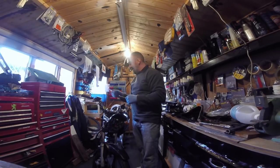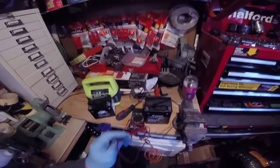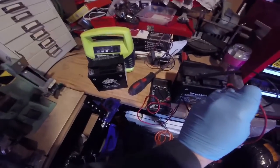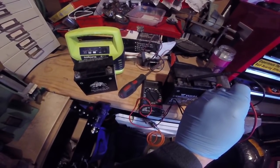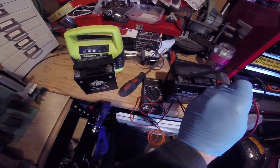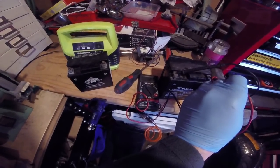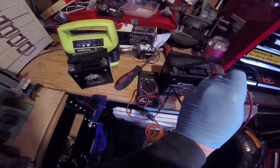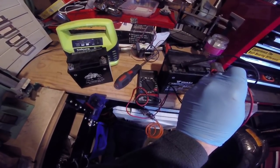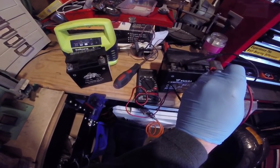Let's get on with putting this cable back on. If it doesn't work I'll have to get a new one. Let's just check the battery - I charged it yesterday. 12.3 volts, not bad. I think I'll give it another charge and see if it holds. Sometimes they still have voltage but aren't enough to kick over - there's volts and there's the amps. The bike needs 6.3 amps, so I'll have to see whether it keeps the voltage.